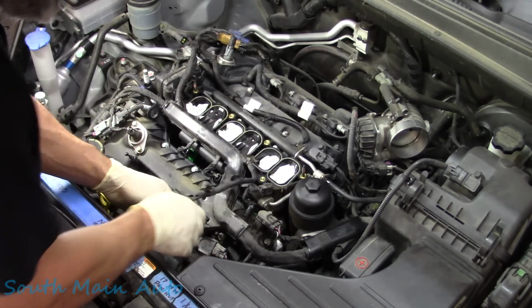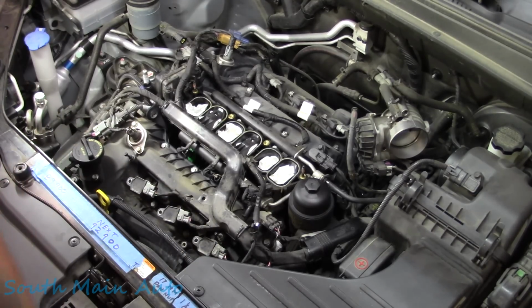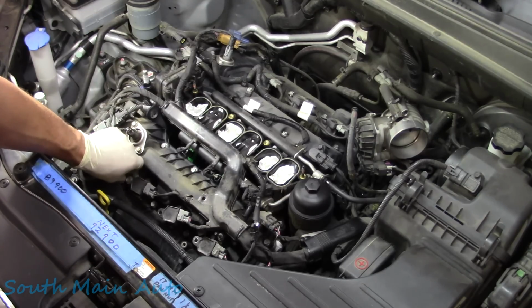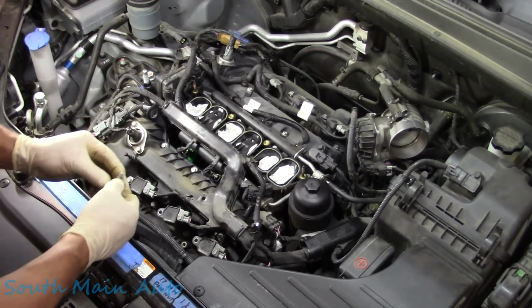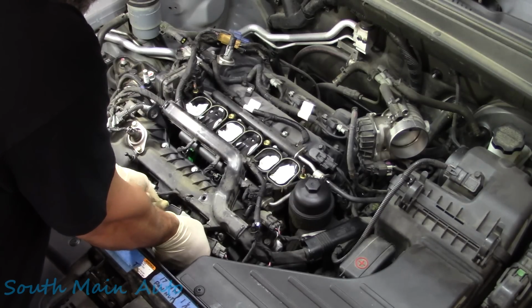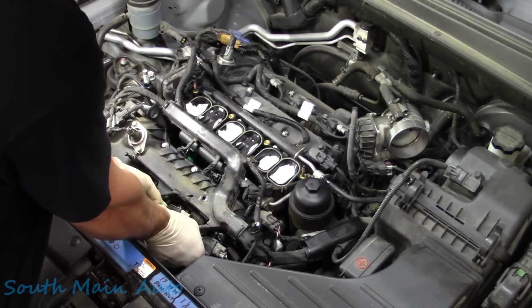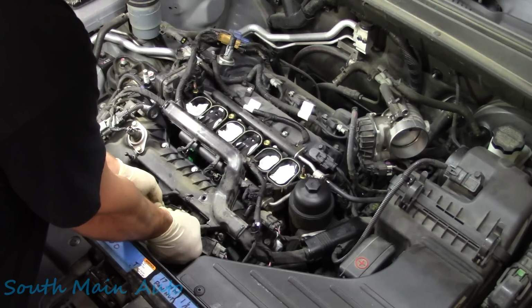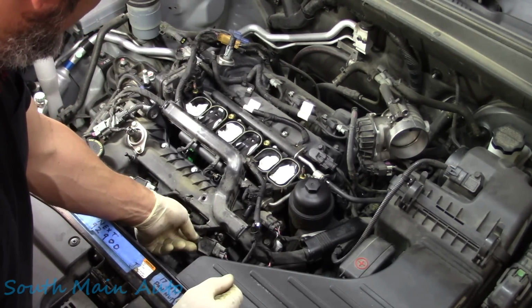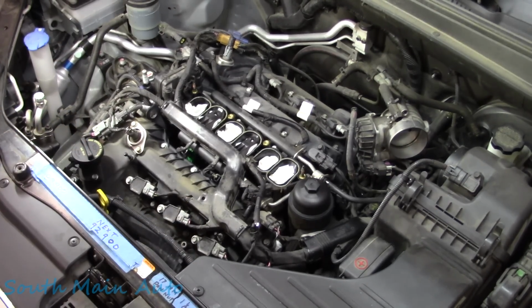And this will insulate around the end of the boot to try to stop the electrons from shooting out the side, because they really don't want to go down the middle of the spark plug. Spark plugs are very high resistance, plus it has to ionize the gap through mid-air in the cylinder. So if it can leak out the side of the boot and hit the side of the head, by golly, it's gonna, because that's easier.